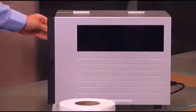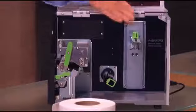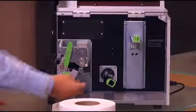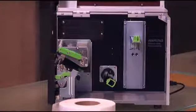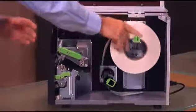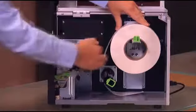To load media in tear-off mode, take the printer offline by pressing the line key. Open the front cover, open the roll guide as well as the media guide. Release the printhead, install your media on the hanger, then wind the media so it is below the media presence sensor.